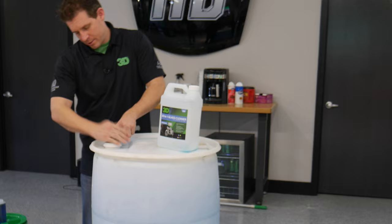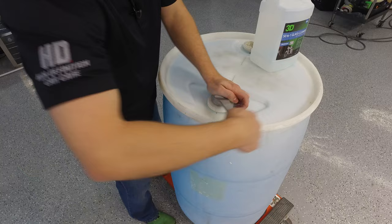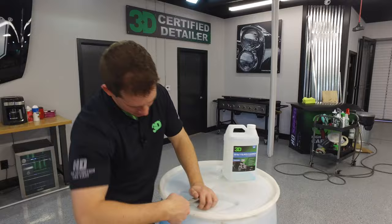It's not ammonia based — which you have to be careful of, because ammonia based products will actually start peeling off your window tint, where alcohol does not. It flashes quickly and it's the best way to get the streak free finish that you'd like.